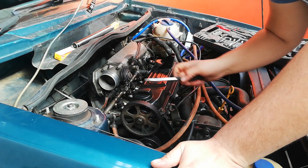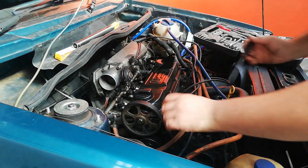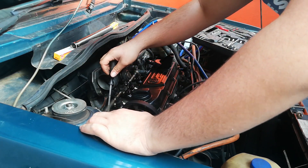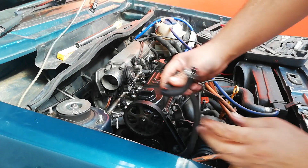We've got some fuel lines going to the fuel rail over here. You guys can see it over there. Just gotta make sure which is your inlet and which is your return. There's still some pressure in the fuel pipes here, so let's get those removed. This one goes into the intake from the fuel filter on top.